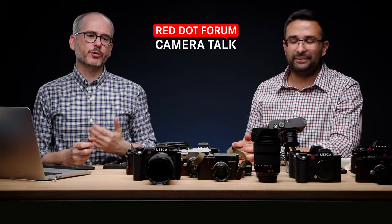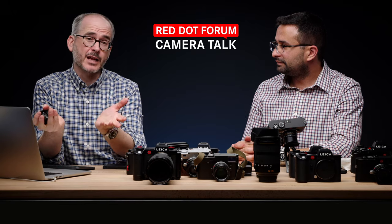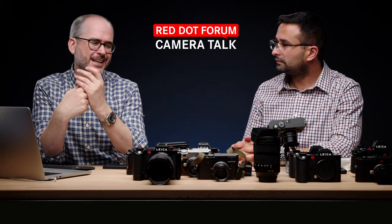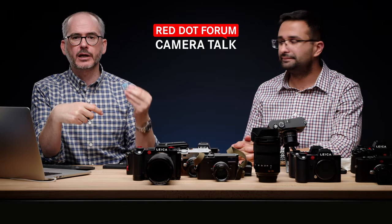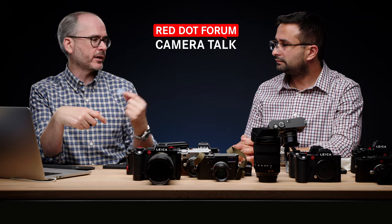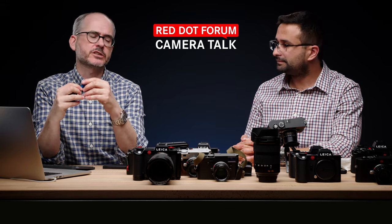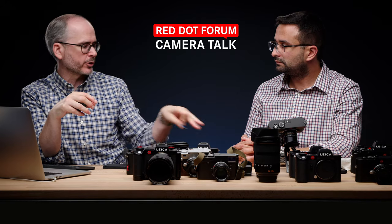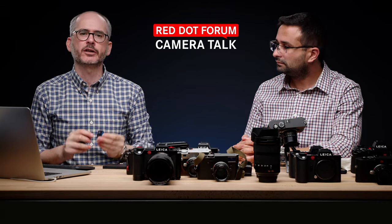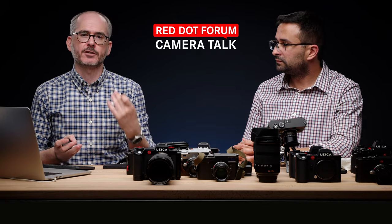Yeah, who knows? So the other thing you can do, if you don't trust the save profiles to card, and it's not a bad practice, if you've done a lot of customization to user profiles and button layouts, it's not a bad idea to have an extra memory card around, and just do a backup of all your settings on the card separately of the firmware. Because then, if you want to reload this in the camera, you just would load profiles from card, and they're all there. So I would say that's kind of the invisible step one, even before you do the battery and the memory card and all that, is backup your user profiles if you've done any kind of customization. Some people haven't used user profiles, so you would have nothing saved in your user profiles.